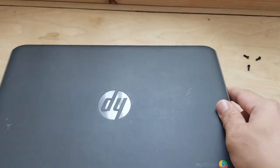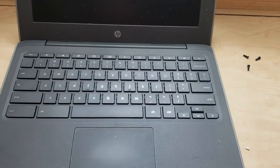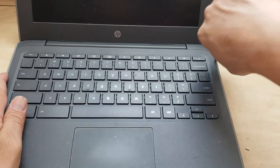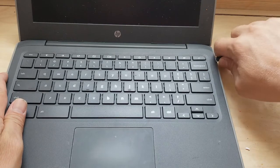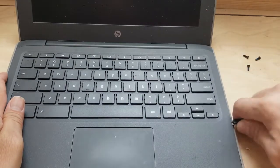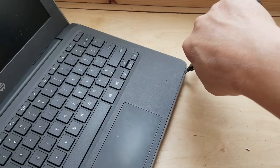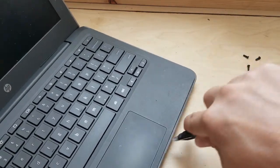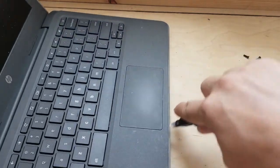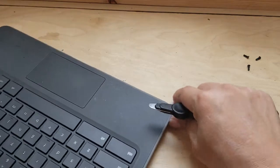Turn it over. Since we're working with the keyboard, we don't have to worry too much about the monitor. With the staple remover, all you do is pop on the edge along the crack and just pop it up slowly. Turn it up so that it pops up — don't push too hard, just take your time through each section. Turn your Chromebook as needed to make it easier. Near the mouse pad, be careful and do it softly. If you hear a noise, that's normal — that's the clip holding the keyboard in place.